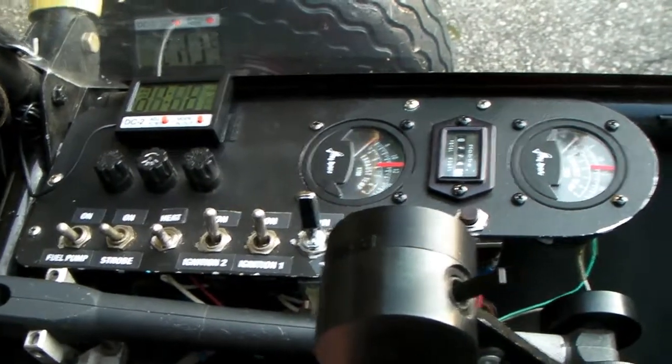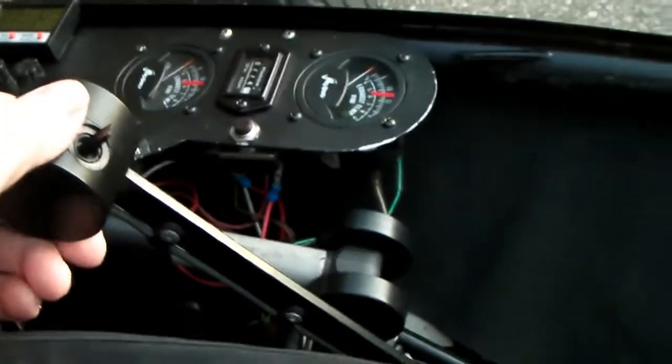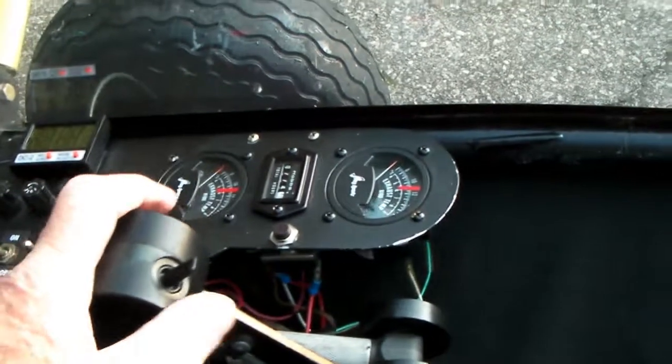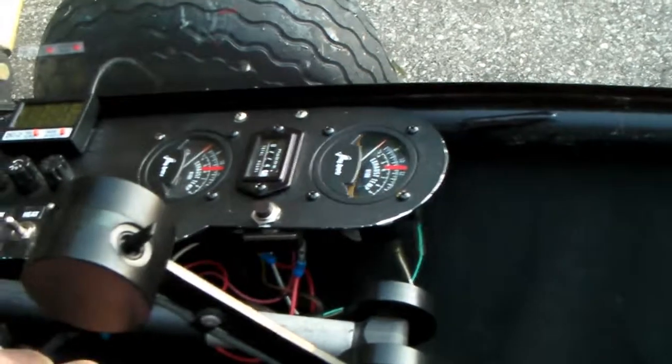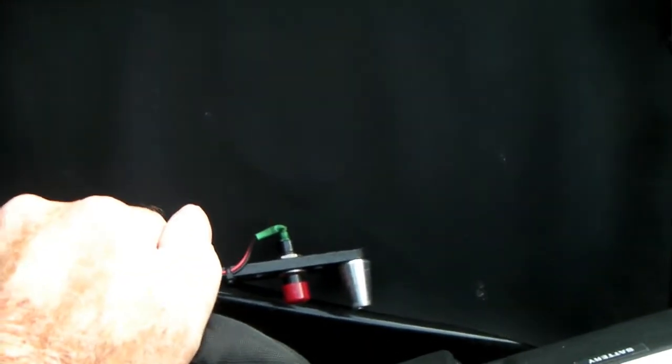The mags are on, and then down here is the choke. Now, two-cycle engine — you have to have this throttle back, all the way at idle. This throttle lever moves a long way, it's like an airliner throttle. So make sure that's all the way back before you start it. They will not start if that throttle is not back, because it effectively disables the choke — you don't have enough vacuum.